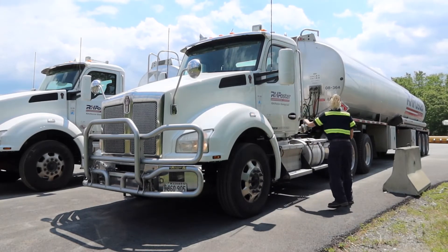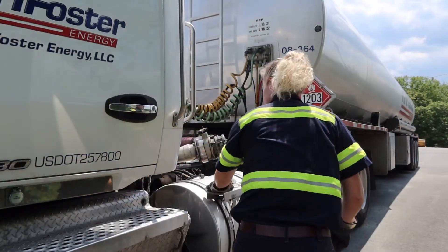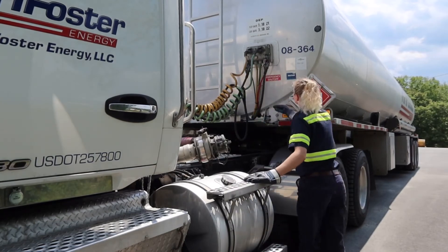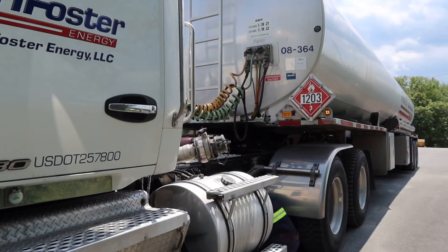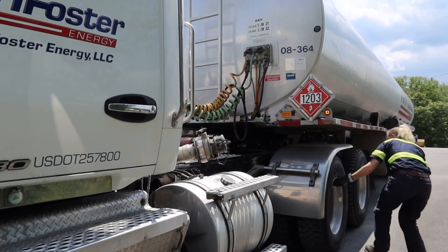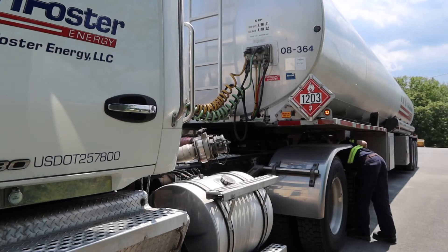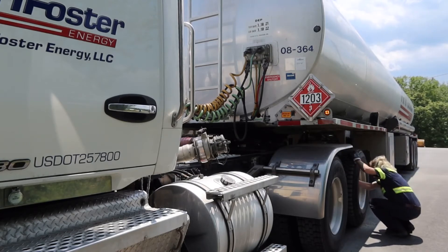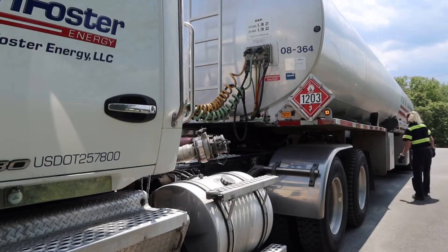I've checked the lights in front and now I work my way down the driver side of the vehicle — checking all of my steps, handles, making sure everything is secure and nothing is wearing out. I check all hoses and electrical lines running from the truck to the trailer. Underneath, I check the drivetrain and center bearings. I double-check my fuel tank was shut properly, then check my fender and all tire and brake components, lug nuts, tread depth, and between the duals to make sure nothing is in there and no rims are cracked.